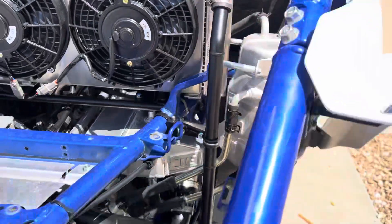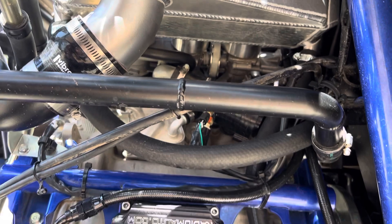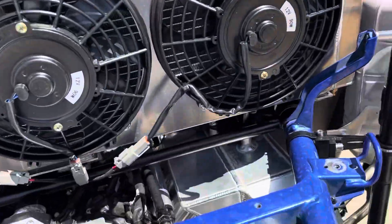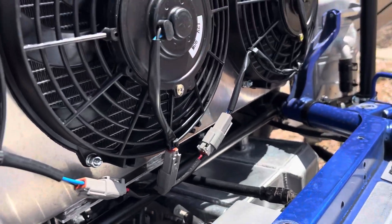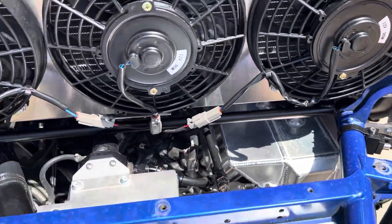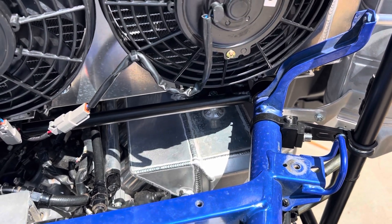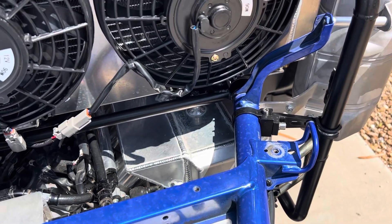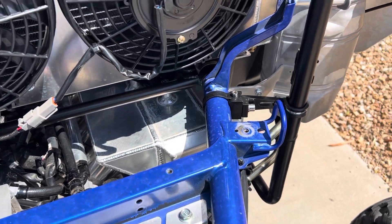Another benefit is when you have this setup you've got all this room underneath to get to your thermostat or whatever else you need, and you still have access to the top of the cylinder head for your spark plugs. You're basically putting the intercooler out of the way — not over the top of the motor where it's baking with engine heat. I originally did one of these on my own car several years ago and I'm still running the same intercooler — done 500 wheel horsepower with it. It's a 750-horsepower Garrett water-to-air core with our air boxes and billet output plenum.